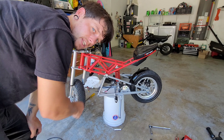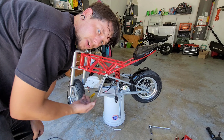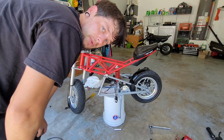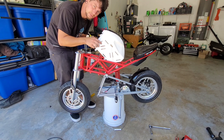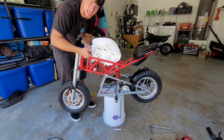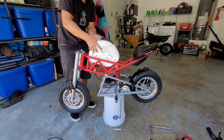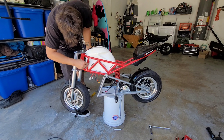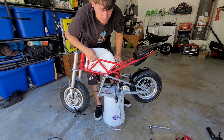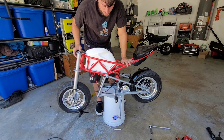Since the front brake is on, that's all we needed the plastics open for. Put the plastics back together: run the rear brake line through first before closing it up since you can't open it once it's together. Make sure wires are coming through and the brake line is going up and out. Drop it in, make sure everything is solid, screw everything back in, pop the little triangles back in — they only go one way. Get the seat back on.